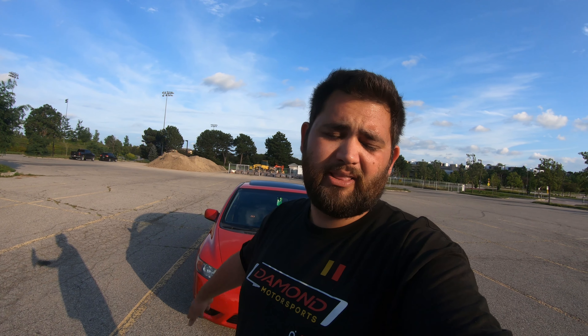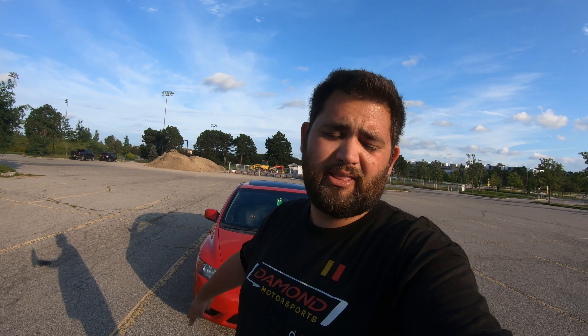My goal with this car is to have a fun daily driver I can enjoy on the street while the Mazda is down, that's also trackable. The Mazda was maybe 65% track, 35% street — this will probably be more like 75% street, 25% track. Right off the bat, I'm doing a throttle body for power, a long-tube header (either Skunk2 or PLM, haven't decided), and then a retune. That should get me to 220–230 wheel horsepower depending on the motor's health. It's got 230,000 kilometers on it, but that doesn't mean much with these engines. A long block is only about $1,000, so I'm not overly concerned as long as I stay on top of oil changes.